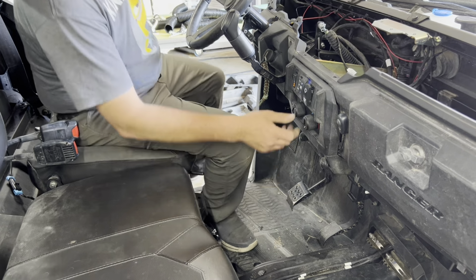Alright, fire in the hole. Now this whole time I have the radiator cap off. What that's doing is letting the system purge there. Grab a little bit too, that'll help. On the temperature, you don't want to get it too hot. I'm at 140.